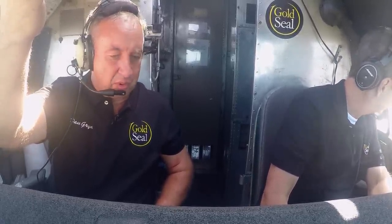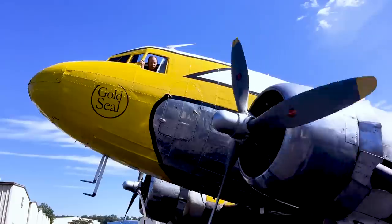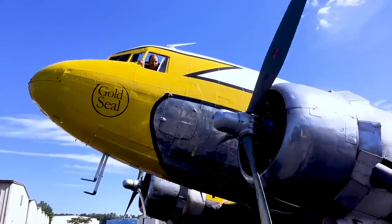Shall we go ahead and do an engine start for number two? All you've got to do is take the Avionics off, and we'll do the rest. Boost pump on, pre-oiler on. Look outside your window there — you're clear. Now I'm both pre-oiling the engine and spinning it. It's doing great — look how fast that thing is spinning. I'm going to let it spin. Pre-oilers off. Mixtures on. Mags. Woo-hoo!